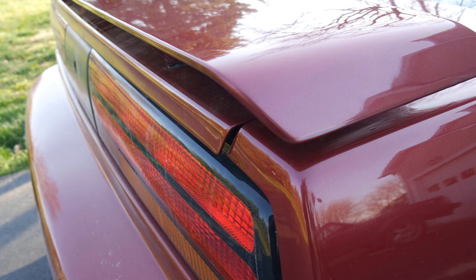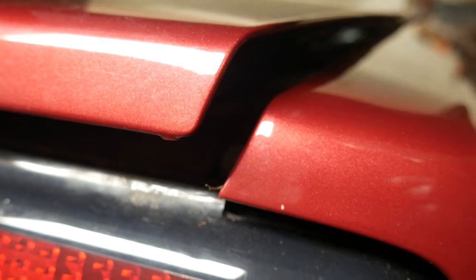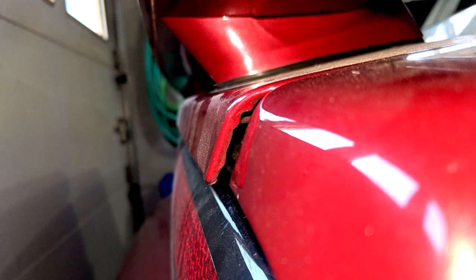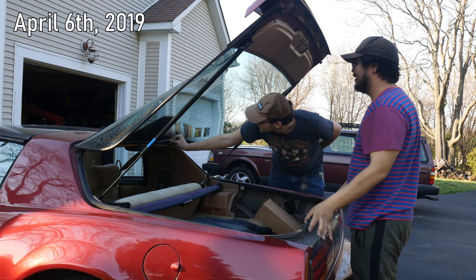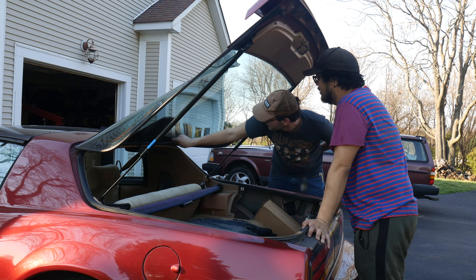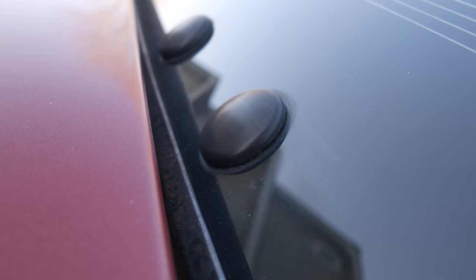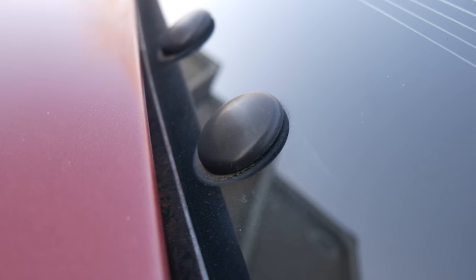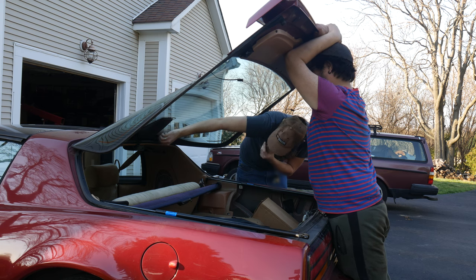On our Firebird it seems likely that both of these points of adjustment have been pushed fully rearward by the lift struts. But I really don't feel like removing, cleaning, and resealing the spoiler lid, so even though it's likely part of the problem, for now we won't be adjusting that. But we can do at least a little adjustment at the forward hinge bolts more easily. The first thing we'll try is just loosening up the glass, muscling it forward, and then tightening it down again. The glass is held to the hinges with four bolts and four nuts. By lifting the hatch up, we can access the four nuts on the underside of those hinges. Then we'll once again remove the lift struts, and with somebody holding the hatch up, we can see exactly how much room for adjustment there is. As we saw on the other piece of glass, there's a little bit of room — not a heck of a lot, but it's worth a try.